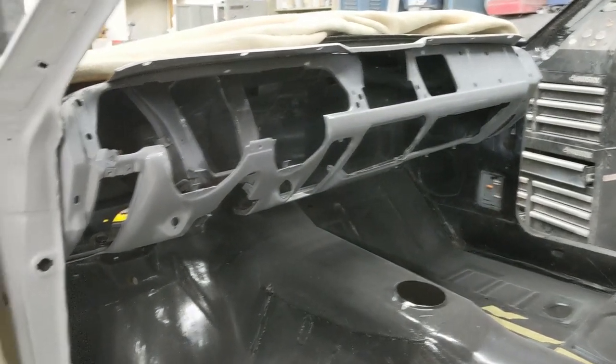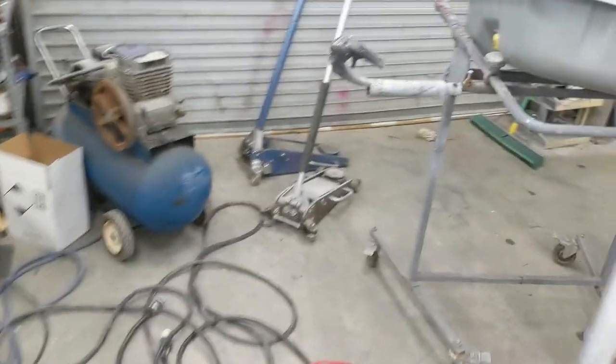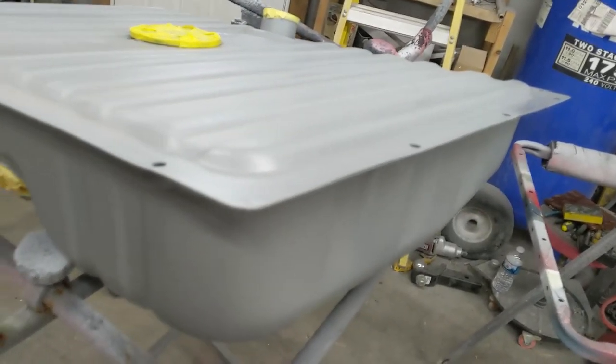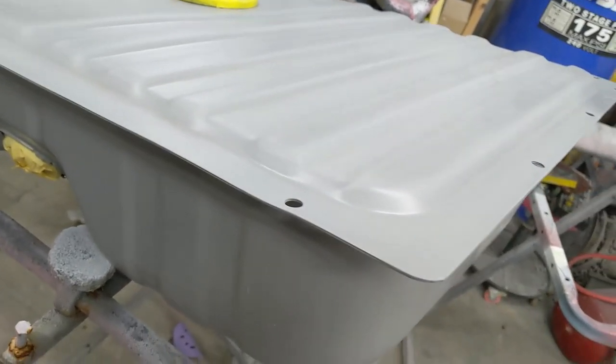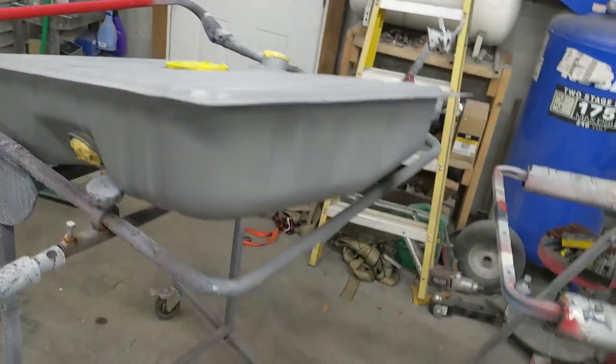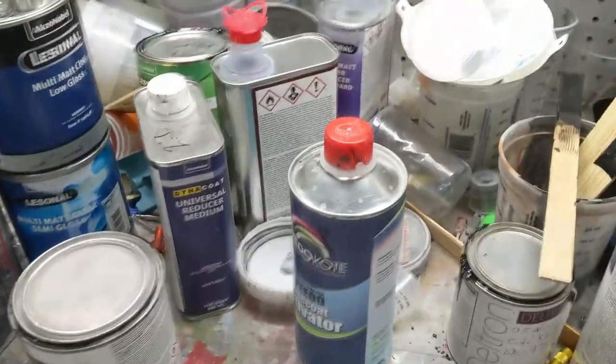Epoxy primer is on, flashed up, all my pieces here primed up: ashtray, steering column, glove box, that's everything there. Got the little spot over here on the gas tank taken care of. We're getting ready to go ahead and spray this up, so I'm going to wax and grease remove this right quick, and I think it's already been scuffed, so we should be ready to go ahead and apply our paint to this. I may run the Scotch-Brite right over one more time,